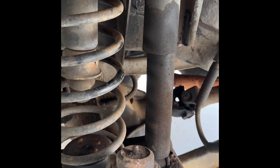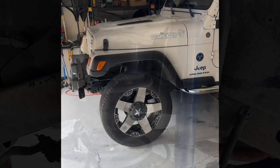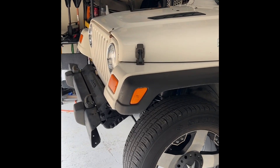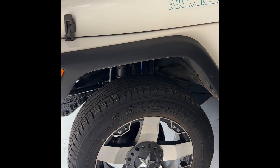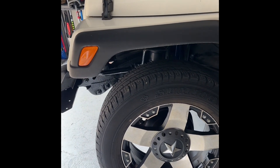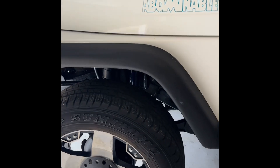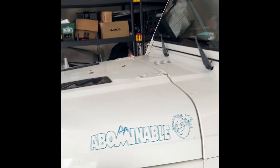As soon as I took off the tire I saw that my shocks were blown, and the sway bar end links are shot, so I had to go buy some of those and fix those as well. Finally got it all done. I had to move the fan shroud for the radiator. I put in the two-inch lift puck in the front. New shocks, new brakes, new sway bar end links. I'll give it a little paint just to make it look okay. I put these guys on top — that was a menace but it looks good.